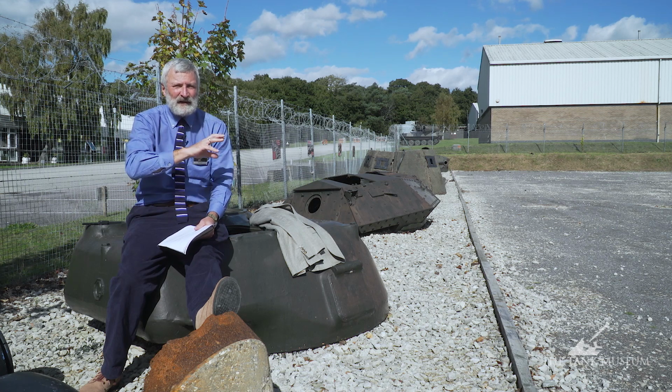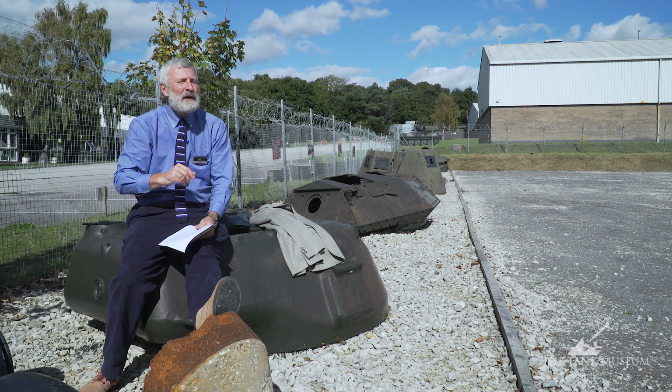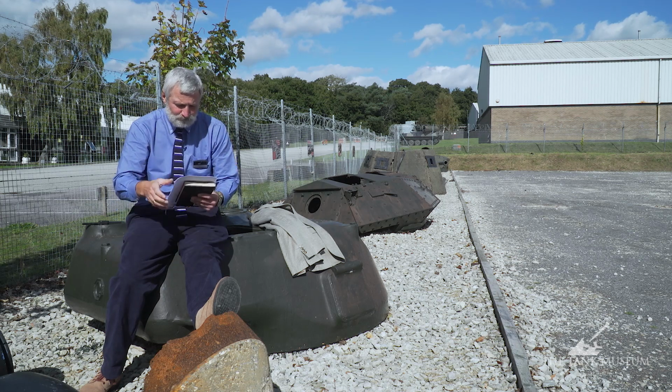And then presumably at different stages, whether it's in neutral or other things, it will be moving at different speeds and sometimes perhaps not moving at all. But the actual drum, interestingly, on the outside that we're looking at is housing the brakes, but it's connected to that reduction gearing, which is why we're seeing it move.